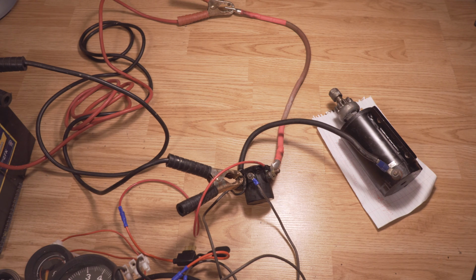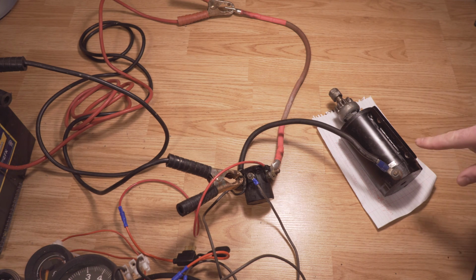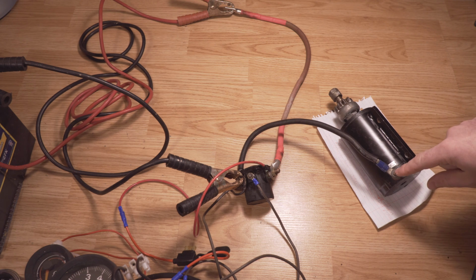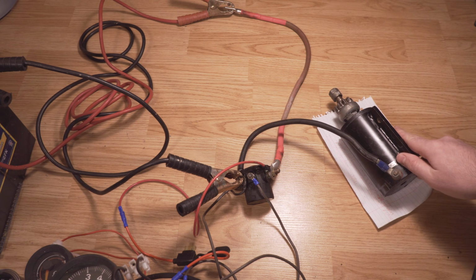So you can hear that? It means the solenoid is activating, and when that's happening, power will go to the starter motor. So if you're hearing this, your starter isn't working, it could be the starter itself, it could be the ground, or there's a good chance one of these cables along the way is not providing enough power. So if you hear some sort of motion happening in the starter but it's not working all the way, it's probably the connection.